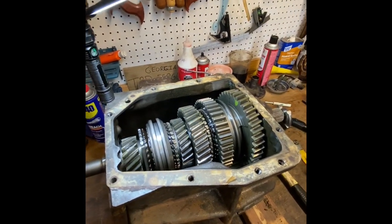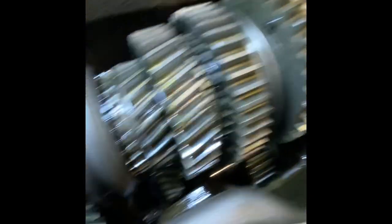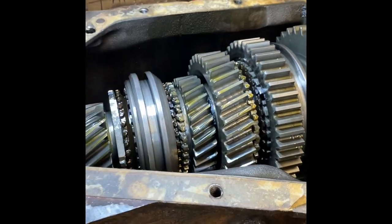And that's bad. Still in neutral, but now I'm turning the input shaft — the output shaft is not moving. But you can see now the counter shaft is moving. There are synchros and some roller bearings in here that need lubrication. So don't think that flat towing with your truck in neutral is the same as sitting with your engine running in neutral — it's not the same. If the engine's spinning the transmission in neutral, it's getting oiling. If the drive shaft is spinning the transmission with the engine off in neutral, the main shaft is not getting oiled.